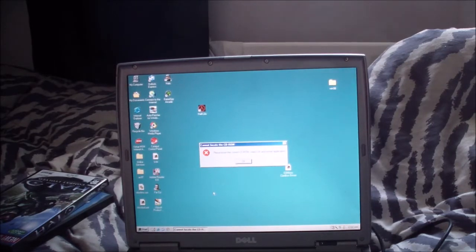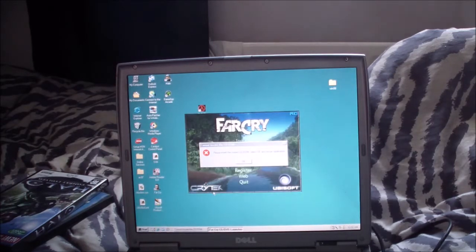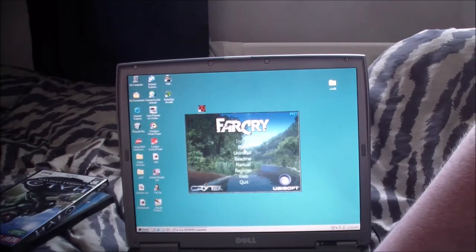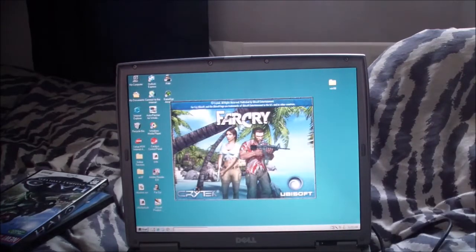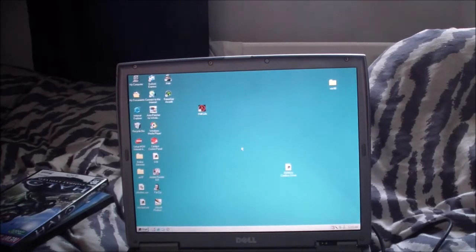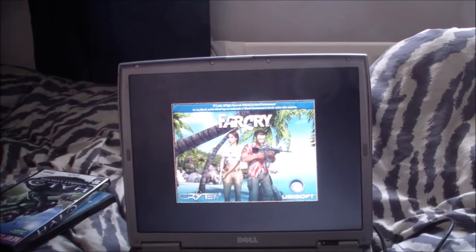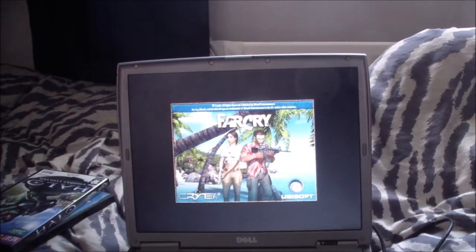This machine is really weird with drivers. The DVD RW stopped working halfway through me trying to get the drivers installed. You have to go into the properties in Device Manager and mess with some values, then it will work just fine. I'm actually going to leave all the resources I used to get this working in the description. If you get one of these and want to try this, I would highly recommend against it because it's annoying, but if you're really determined you can get some things to work. The only things I haven't been able to get working are the USB and the PCMCIA drivers.